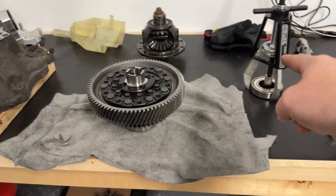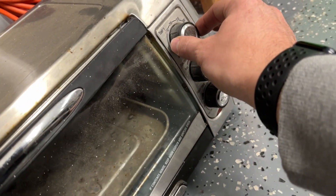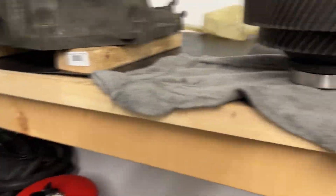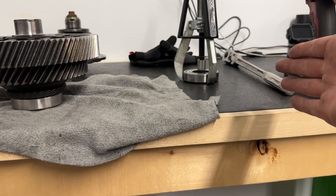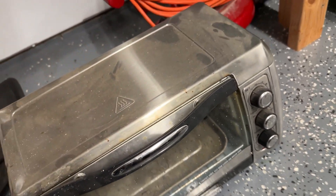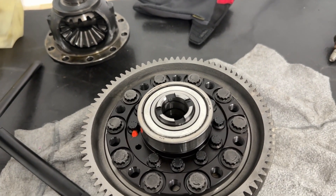You don't need a hammer to put the bearings back on — you need one of these. Set this toaster oven to about 200 degrees, maybe a little more, which is not a temperature these bearings won't see. Transmissions easily get up to 200 degrees bolted to an engine, and with fluid shear there's no rubber in the bearing, just a steel guard. Turn it up to just over 200 degrees, set it to about 15 minutes, throw the bearing in there, let it get nice and warm, pick it up, put it on — and you'll see no hammering needed at all.